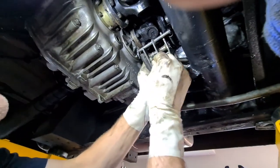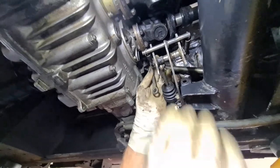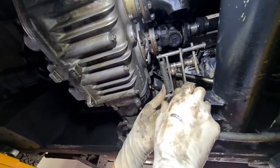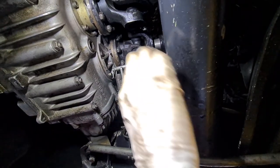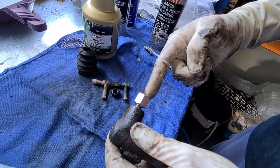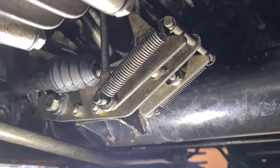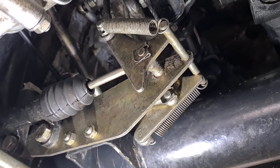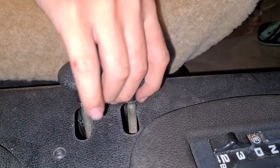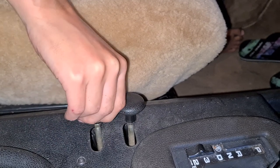I had to let him play the computer for a few hours after this. That is the rear differential lock lever. This is part of the reason I realised there was a problem with that silver bit on the master cylinder — the lever wouldn't go up and down freely. The angulation of that bracket is the bit that needs to come off; do not put it in if yours didn't have it. Rear one up, rear one down, front one up, front one down — you can see they're all moving freely now, which was great. The lever positions can be adjusted.